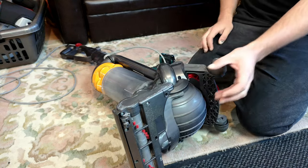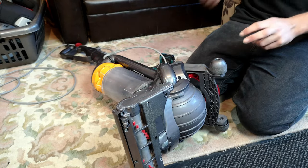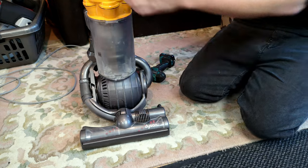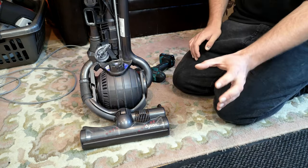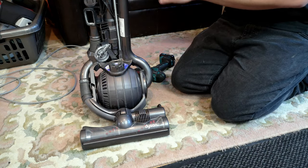If the DC40 does this, it will blow a segment of the commutator of the motor completely out. You can rotate and feel the remains of the destroyed carbon brush drop into it and then come out of it, and that's usually a fair indication.